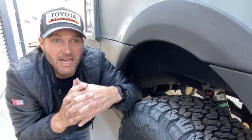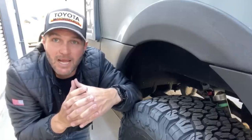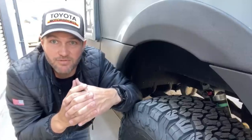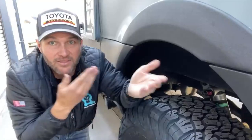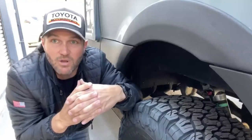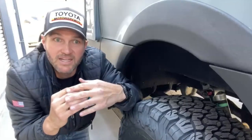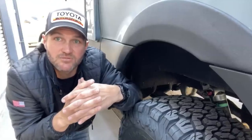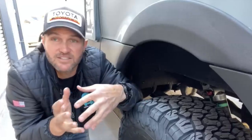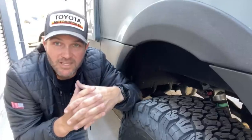And while Mercedes might have a high gross vehicle weight rating for their Sprinter, it doesn't mean that's the optimum performance of that suspension. So if you put a few thousand pounds in a Sprinter van, will it collapse and fall over? Not at all. This van's built out. It has a few thousand pounds of stuff in it. Does it handle well? Does it perform well? Is the suspension set where it's supposed to be as far as spring rate and its operating potential? Absolutely not. So that is why you can buy a van off the showroom floor with suspension that doesn't necessarily work or is not optimized for the job that we're asking it to do. Hopefully that makes some sense.